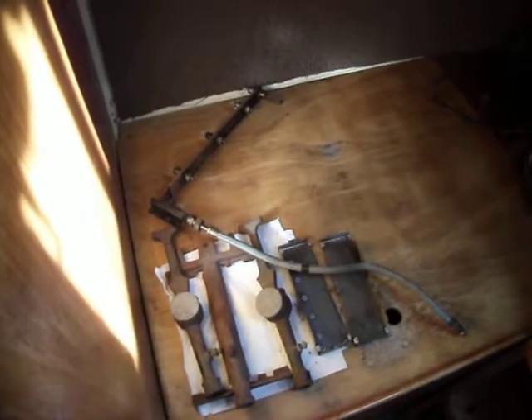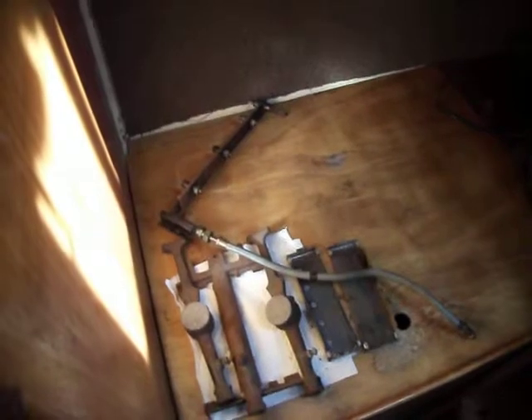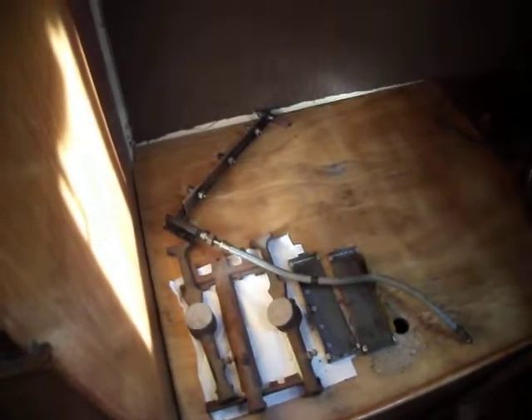I think we're well on the road to making this stove safe. I'll take these parts home, put some compressed air and a gauge on the manifold and see if it leaks. I'll test it with soapy water — I don't need to use propane, compressed air is fine. If it leaks we'll find the leak and weld it up and fix it that way.